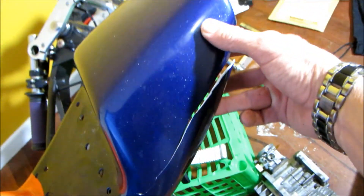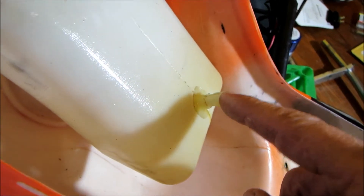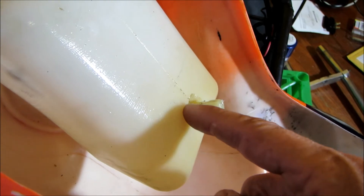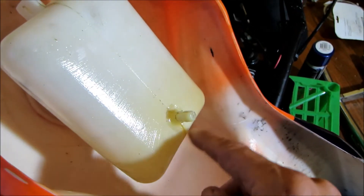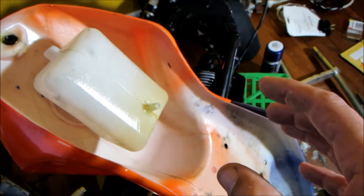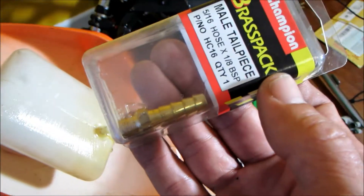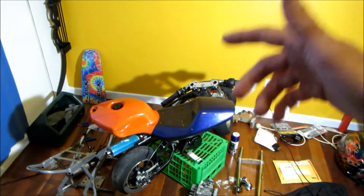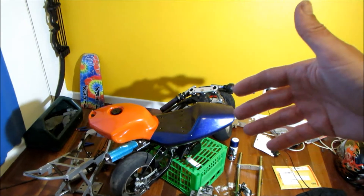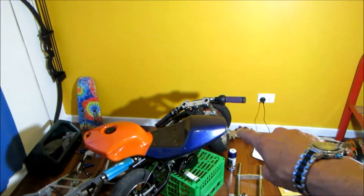It's got a massive crack there. Also on the spout here, it's cracked around the bottom and it actually leaks out fuel. I've tried to put some glue around there, but that didn't seem to work too well. So what I'll do is I'll probably cut that off and try and screw that one in and see if that makes a difference. I'm going to take this cover outside and try and fix it with a little bit of fiberglass. Try and fix that massive crack in it.